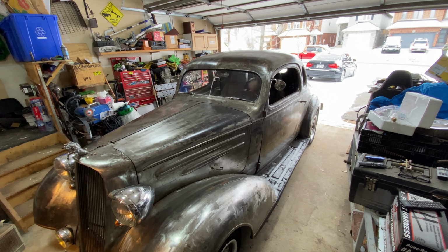Well, that seemed to work. Quite happy with that. Time will tell whether or not it actually drives properly. But definitely a big difference there with the putting it into gear thing. Sometimes it nearly stalled when I put it into gear because the revs dropped. And I think that's got something to do with the mechanical advance.